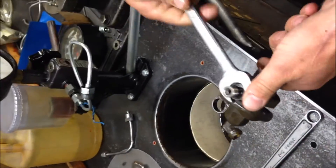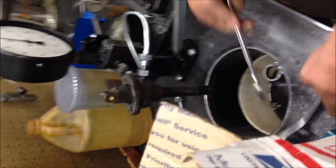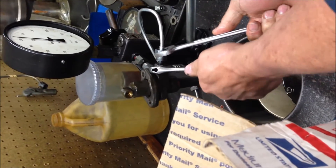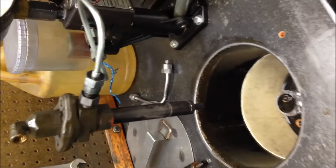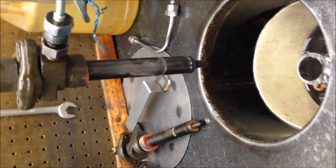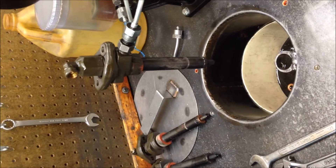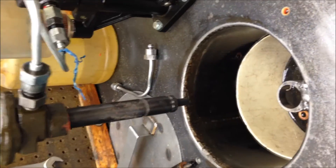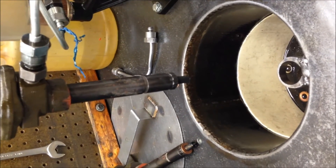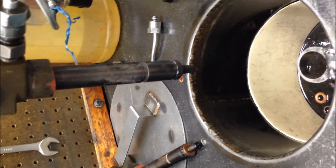Do you think that maybe running them and cleaning them up might help them? Oh yeah, we could — we get about $24 each, lap them, shim them, set them, give you some new coppers — about $144 for the set. That's much more fanned out. That just means this one's probably got four or five holes that have gotten elongated — they get bigger from years of jamming fuel through them, they just get out of round. But it's holding, it's pressure to close, but they're not doing what those other ones are doing. I think they're probably just a little more worn than that first set.